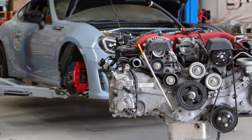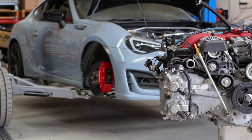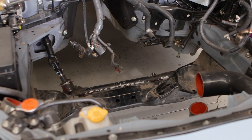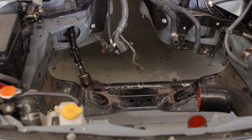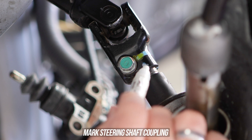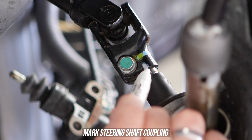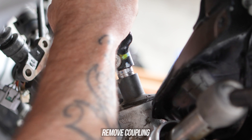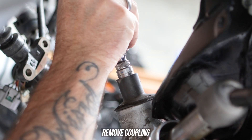Now you can either prop your motor up to the chassis and remove the subframe from the chassis, or if you've been sitting on the red line a bit too much lately, you might need to pull the little engine that could out anyway. In our case, we've pulled it out for reasons you can only imagine. After you've finished perving on your naked chassis, go ahead and mark the steering shaft to the coupling as you can see we're doing here on the screen. Then go ahead and zap off that coupling bolt and wrestle it off the steering rack for now.